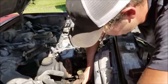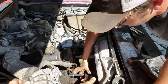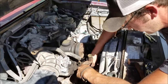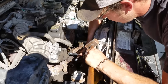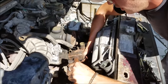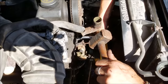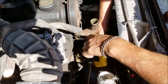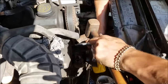We're getting our thermostat housing off - it's a 10 millimeter. The 2.3 liter is kind of interesting as the years went on: the block is from the 70s so everything's pretty American down there, but the cylinder head - the eight-plug unit - has a lot of metric stuff because it came along at a later date. I'm hitting my socket with a hammer because these are pretty tight. If you use a big breaker bar you're just going to shear it. The rust and corrosion is holding it in there, and when you shock force it a lot of times it'll break that free so you can get your hardware out without snapping it off.